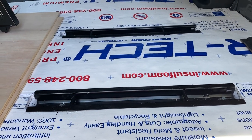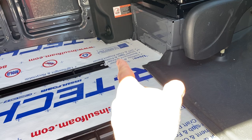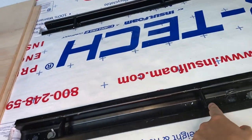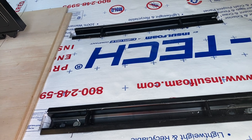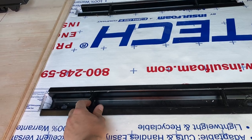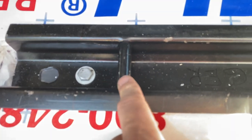You need to be mindful of a couple of things. One, there has to be some distance between the front of the brackets where the seats will end and the front of the driver's seat. Also, the brackets have a front and a rear — we didn't realize this in the beginning and installed them all backwards, which was a pain. This beam here is a little slimmer than the other one, and the latching mechanism will only latch into the slimmer front one.